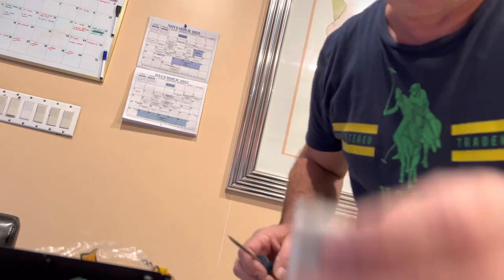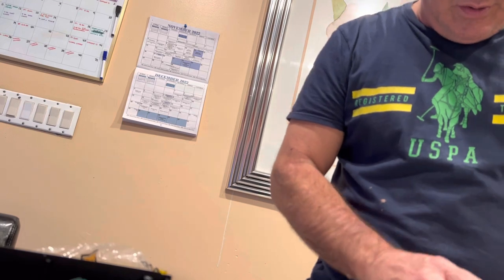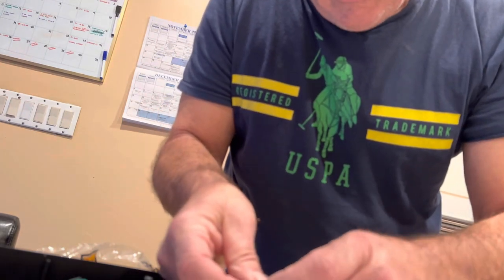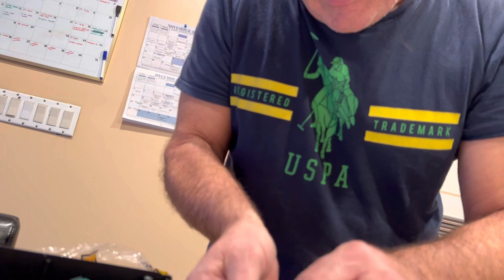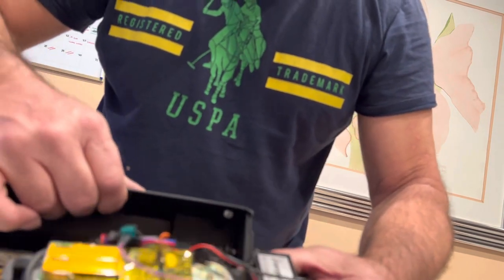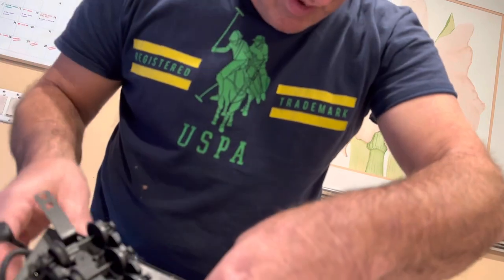Dead, dead, dead battery — but it looks just like a 9-volt. Now I take my replacement, which is really 8.4 volts, and pop this in. When I put this on the track we should have Proto sounds, and that'll be the next video. You snap that in, put the battery in, slide the back end, the front clips down — clipped in. That quick, that easy — there's your new battery. Go with the Energizer; it's actually 8.4 volts, not 9 volts.